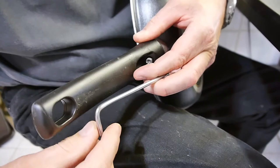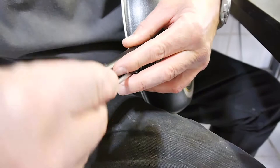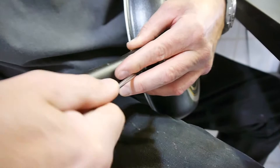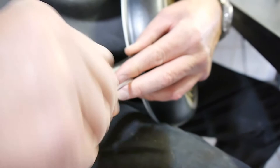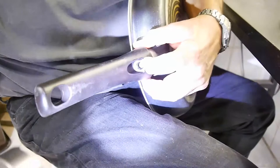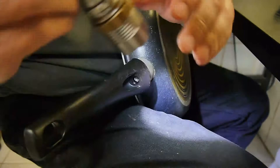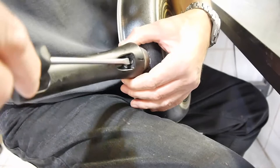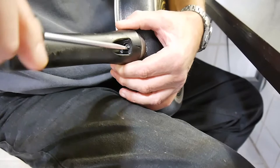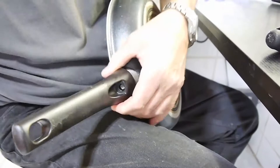Now this one - I don't know what size this one is, it's a small one anyway. I'm sure they're all slightly different but the handle can't be too big. So what happens is when you get this screw out, don't forget these things have been in the pan for two years. So they're going to be rusty, they're going to be difficult to get out, they're going to be full of crud in there. You might think oh that's flat, that's just a rivet or something, but it's not. If you poke around in there you'll find there's a screw. Clean out the hole as best you can - this Torx hole here - and then just undo it.